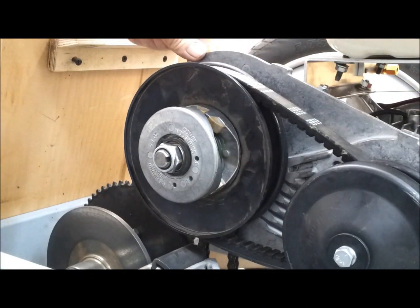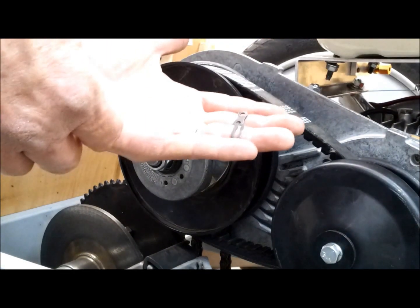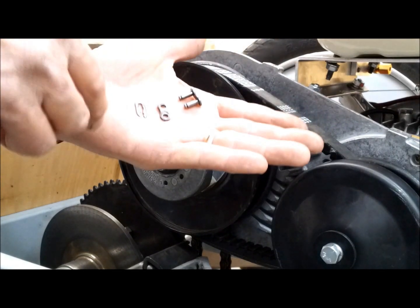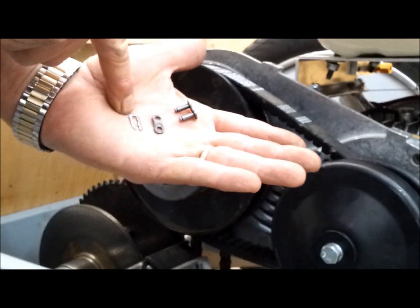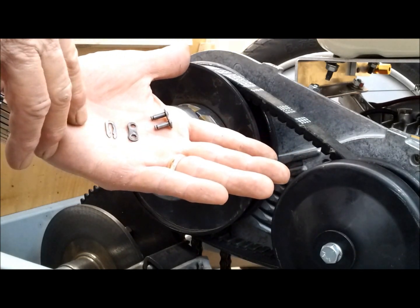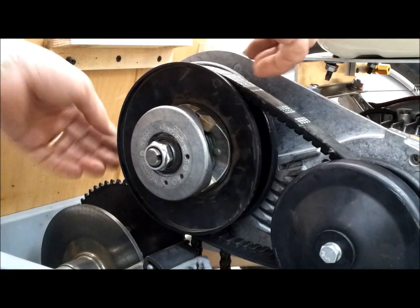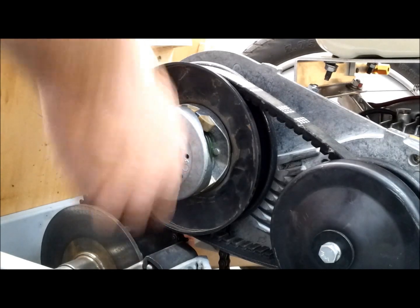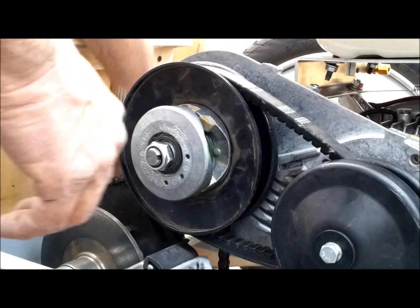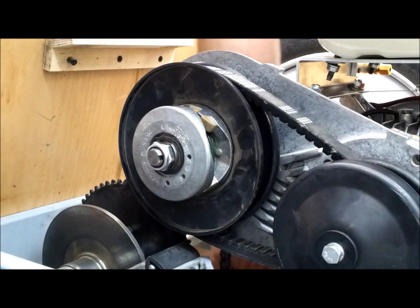Let's put on the chain now. I have the motor loose and far forward. I've got the master link here. This is the sequence they go in. It's my understanding that the round end here installs on the chain in the direction of travel. Don't quote me on that, but I think that's the way they go. So, let's put these up here. Alright, so the chain, you drop it down through. And then work it around the sprocket.